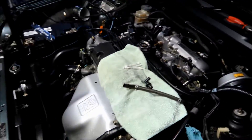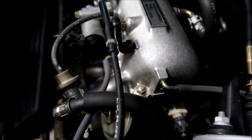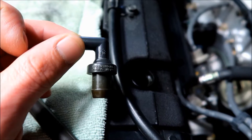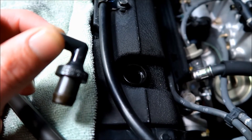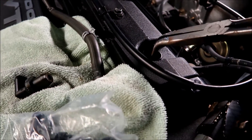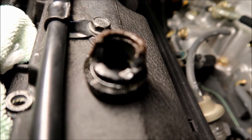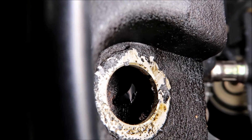We just got home and there's a slight whistling noise coming from the intake manifold — I'm assuming it's a vacuum leak. I asked a couple of guys in the Prelude community and they also believe it's a vacuum line. I was looking at this PCV valve and putting pressure through it — it blows both directions when it's supposed to blow one direction only. I pulled the grommet out and it just ripped apart, with the rest of it falling inside the rocker cover. The o-ring was so old it just fell apart.